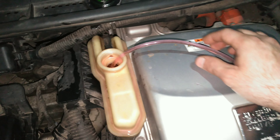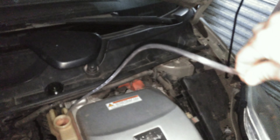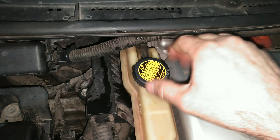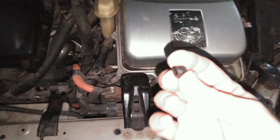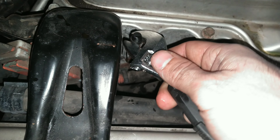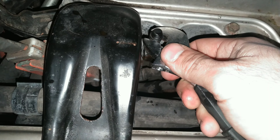After you've got a nice clean flow for about five minutes, tighten the bleed valve by hand and pinch the tube off. Raise the tube above the reservoir, let go of the pinch, and let all the coolant in the tube drain back into the reservoir. Take the tube out. Put the cap back on — that's how easy it is to change your inverter coolant. Then take the little black rubber cap and put it back on the bleed valve. Tighten it with a wrench — but not too tight, because you do not want to damage this bolt or you'll have coolant spraying everywhere.